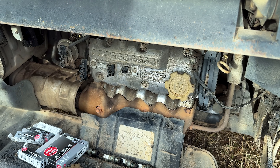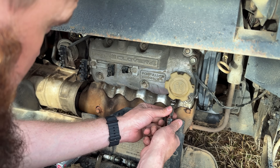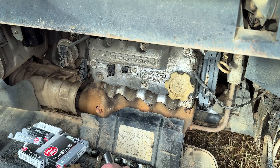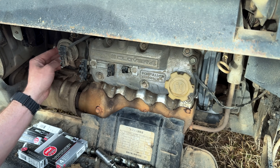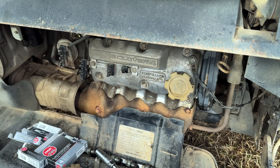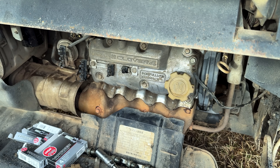We'll make sure our gap is consistently right at one millimeter - or 1 to 1.1 as the spec says in the manual. Get these in, grab the old torque wrench, torque them down to 21 Newton meters. We'll get those plug wires saddled up and ready to go on the new cap - nice and shiny even though it's a Denso cap. I think these actually call for Denso spark plugs from the factory, but most people switch to NGK, which doesn't really matter. Subaru has consistently used NGK spark plugs and I've seen no issues as long as you replace at the correct intervals.